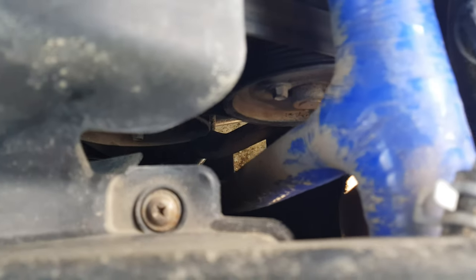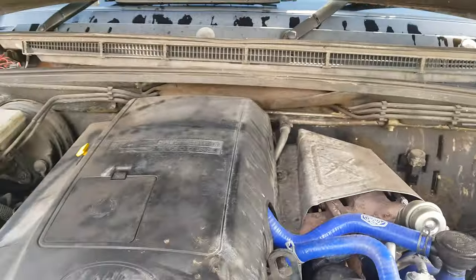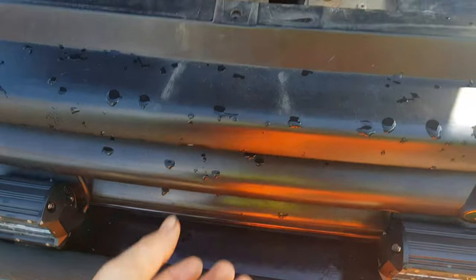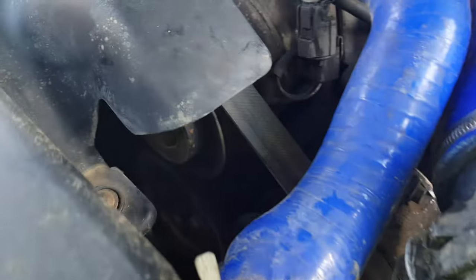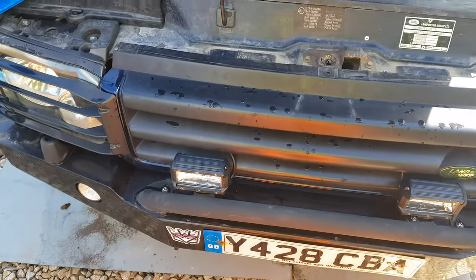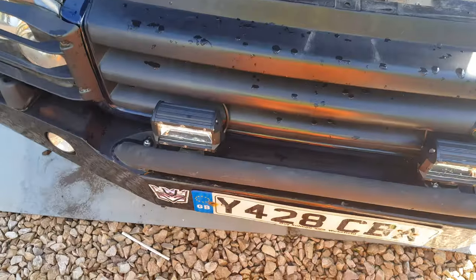so after a day of off-roading, you see all this muddy water. I mean, I've washed this engine since, but you see how the fan at the front, as the mud and water comes through there, the fan down here spin drying flicks it all over the engine, and you can see how far it's got looking at the sound insulation. So that's why it's a good idea to fit a muff guard or a radiator guard. Whenever you go wading through mud or water, the idea is you fold it down, it covers the grill and pushes all the water away and not feeding it through the engine.